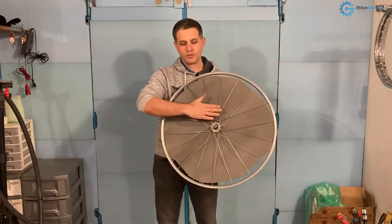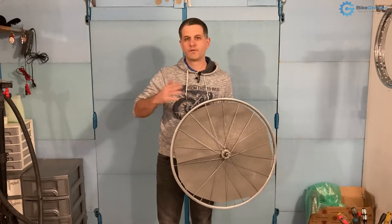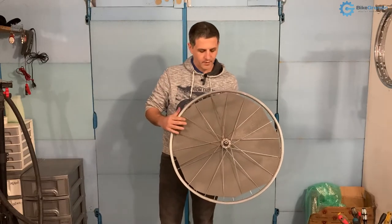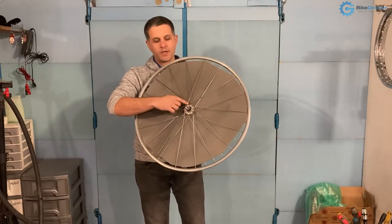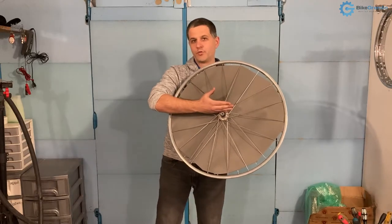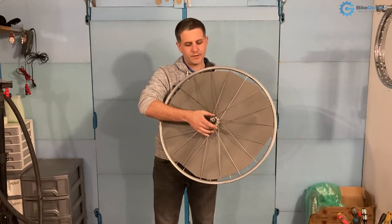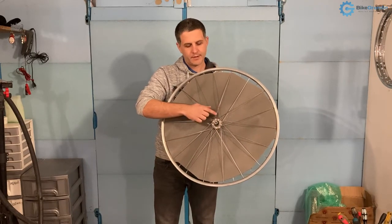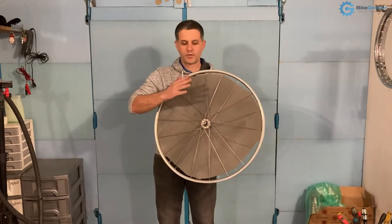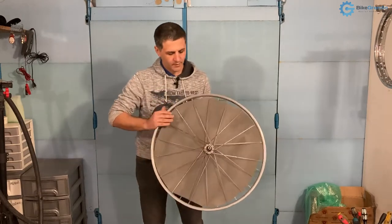So that's what we mean by crosses. Now, why do we see motorcycle wheels with 36 or even 40 spokes laced only two across? There are some limits. The first one I mentioned is regarding having the adjacent spoke hole stay clear — not blocked by one spoke. That can be helped by increasing the flange diameter: a bigger hub creates more room, so with the same number of spokes and crosses we are less likely to have that overlap problem. However, there is another problem.